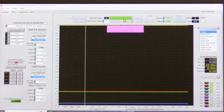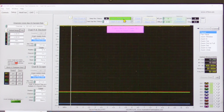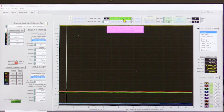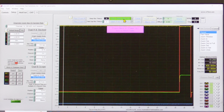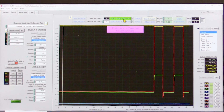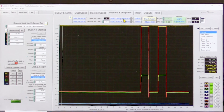We've introduced our fault to the AC compressor clutch control system, and we are going to attempt to energize the system again and capture the data. I'm going to be manipulating the relay coil on the control side, just as the PCM would be doing if the engine was running. We'll capture the data: energize the relay, release it, energize the relay again, release it, and we will save this data to analyze it comfortably at our desk and compare the two waveforms to see if we can determine what the fault is.